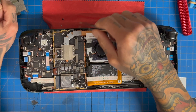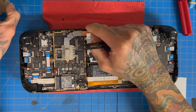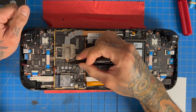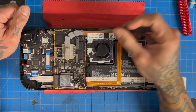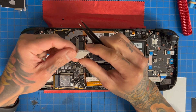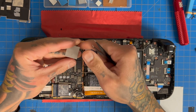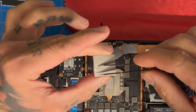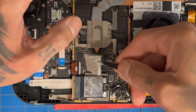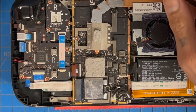These are one millimeter pads stacked on top of one another to make a two millimeter pad. Secondly, we have our original thermal pad that sits right here dead center in the middle — that's stock on the fan already, there's a cutout just for that one piece. As we move down, we have our VRMs: one here, one across the center here, here, here, here, and then our controller here, and the MOSFETs right there. The MOSFETs already have thermal pads — these are one millimeter pads on each MOSFET. We did that because the original thermal pad on the heat shield wasn't making great contact with the MOSFETs, as evidenced by the lack of an indent. So we put one millimeter pads on each MOSFET and then place the thermal pad right on top of that.